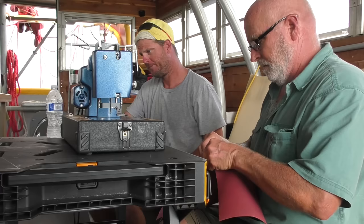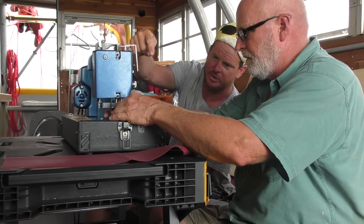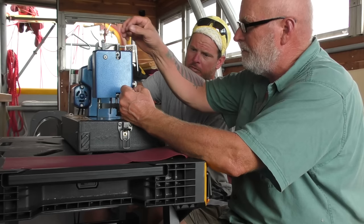Yeah. All right. Well, but the latch, the indent on the needle is on this side. Right. Because the hook comes off this side. So when it pushes the needle through, it makes the loop, and that indent is so that the hook can come through there and hook it. See what I'm saying? So I all of a sudden just started threading it right to left instead of left to right. Yeah. Stick it through there, like I said. And I'm getting old. Man, stuff happens.